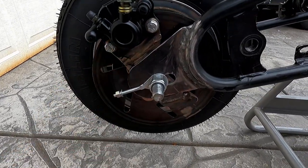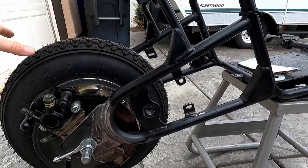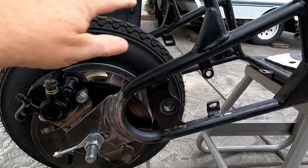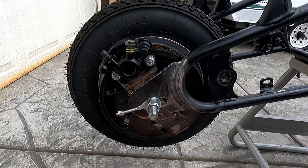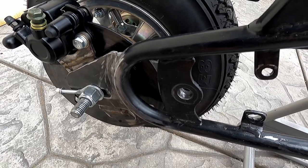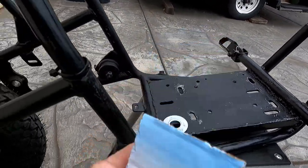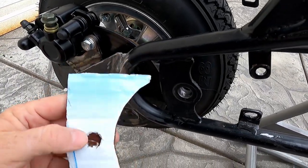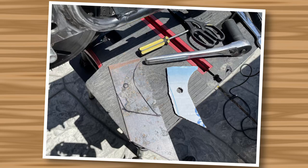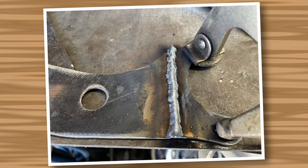I still need to add something here and clean up all these parts. I'm going to take this off because I'm actually going to put the fender back on, and I'm going to move that mounting point back here on a piece of tubing. So I still have my fender. Let's get going and get the brakes put in. One thing before we get started with the brake line — the brake bracket that I made for this. I have a template that I made to fit on here, and that gave me the size of metal I needed to cut for the bracket. I'll leave some pictures of when I put that together, cut it, and mounted it onto the minibike.